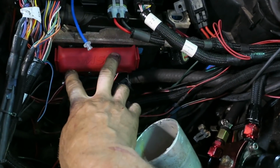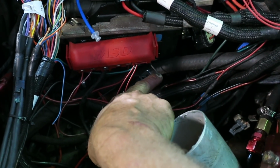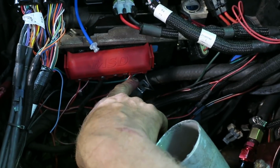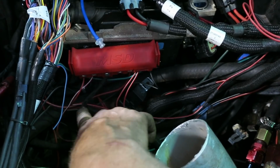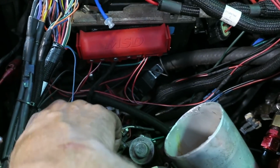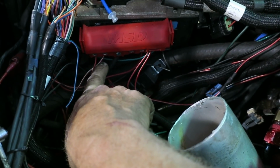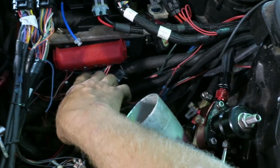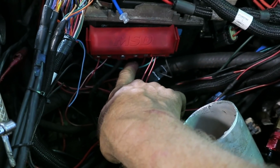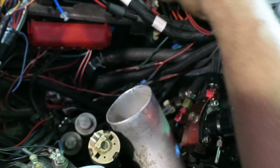Mounted this MSD solid state relay just to keep things clean. You put ground on one side and you can turn the relays on either with key power or with the ground down below. It's pretty slick. One main battery coming into the middle and then feeds going out. So this will turn on the two harnesses, one for the fuel injectors in the main harness and the other one is for the transmission. That turns on the valves, they're separate. That is my fuel pump, which goes to the back. I'm gonna mount all this stuff nice and neat in a little bit, but we're gonna try it, make sure.